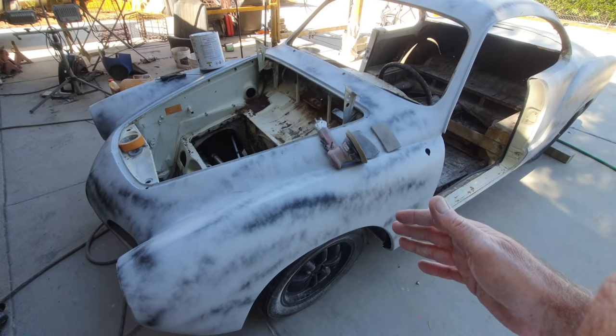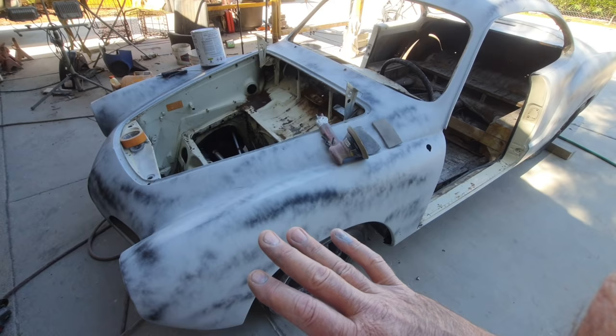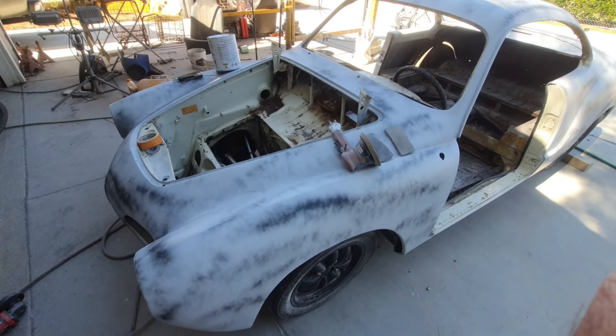The technique that I use is, I do a kind of a rough-in on my body work. I go through and do the filler really fast, because it's a faster method. I don't worry if I've got a few low spots, or if it's a little bit wavy, I just run it. Then I put my first coat of primer on, and guide coat it.